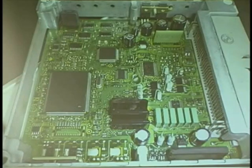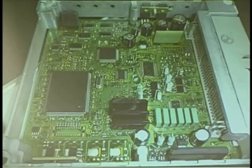Then, dude, smoke. So we pulled out real quick, and I said, wow, let me check all your wiring. I checked all the wiring and couldn't find out what it was. It was on a Nissan. So Richie went out there and checked everything over. He found something I overlooked: the electronic motor mounts circuit was shorted. I'm like, dude, electronic motor mounts, where the hell did those come from? It's just something I didn't know about in that particular car. Apparently Nissan is having a problem with electronic motor mounts, and they just disconnect the motor mounts, leave them disconnected, and put new computers in. It was just one pin I didn't check, but it took out the used ECM he bought. Thank you, Rich. Good man.